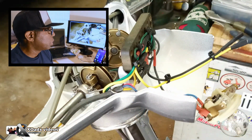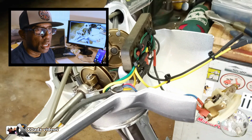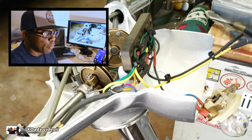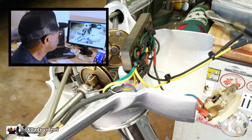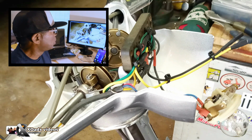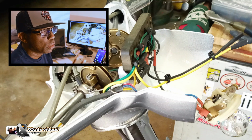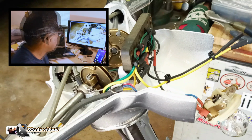In the headset on these old Series 2, they have like a little block where you plug your wires in. The best way to do it is run your wire straight from your switch to your bulb. You want to do it like me, you just want to use that to hold your wires in place, and don't bother plugging wires into that brick thing.